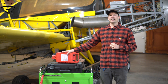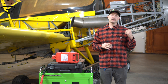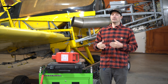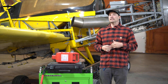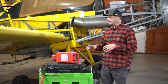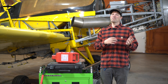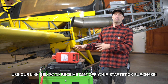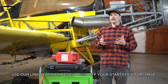I think you've gotten the gist of how much Callie and I like having the Start Stick around. We've found it to be an integral piece of equipment in our operation, mainly because the motors on these airplanes cost anywhere from $150,000 to $300,000, and if you hot start one of those, that's money you're out of — the insurance company is not going to cover that. Plugging this in ensures we're not going to hot start the motor. It gives a quicker spool up resulting in cooler temperatures, and that is everything that is going to help me sleep at night, especially if I have other pilots starting these. It should also be mentioned that this is reliable power. With the wagon, it was give or take on what kind of charge we had — if one battery was a little worse and you didn't know it until you were seeing hotter starts, we don't have that issue with this. We put it on the bench, plug it in, charge it up, put it on the airplane, start the airplane — it works every time and we're never questioning anything.